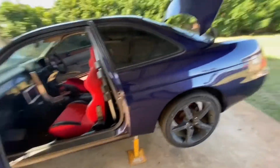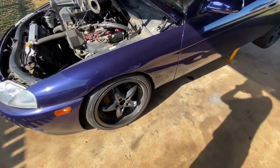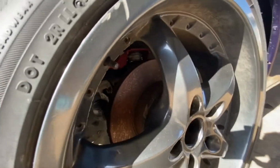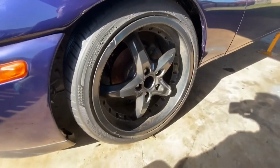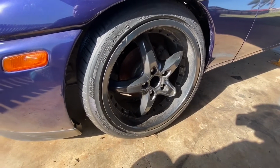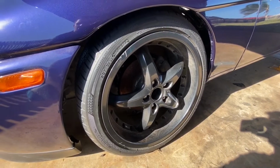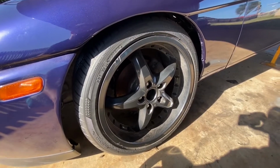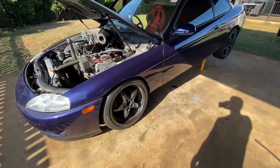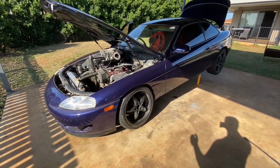Suspension wise, there's not much else crazy going on other than we're using Zaz adjustable upper camber arms. Hard to see here, but there's a bit of red there. Modified steering knuckles as well, so they've been shortened to increase the angle, which helped a million times. Before, I'd quite often run out of lock on these things stock, spin out, and it is what it is. You can only just fight with that, but since modifying them, they've been great. One of the best mods to the car drivability wise, to be honest.